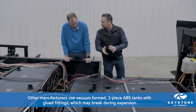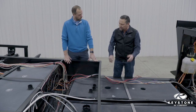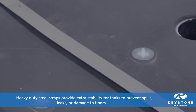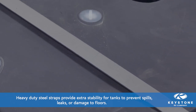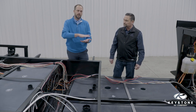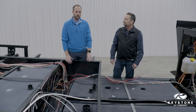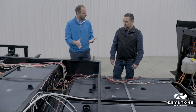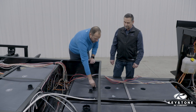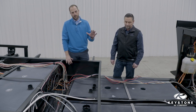The tank will flex and allow that movement without breaking the pipe. The other thing we do here is — because these tanks expand when they fill up — this is a basement area, pass-through storage, and we put big heavy steel straps across the tank to keep them from billowing up, which might push your floor up in your pass-through storage. For people that haven't seen one of these get filled, that tank is going to expand and contract as it fills with water, and also as it goes down the road, customers traveling with any liquids in their tanks will have a tremendous amount of weight there. The one-piece tank with no seams gives the peace of mind customers want, and those straps keep the tank in place.